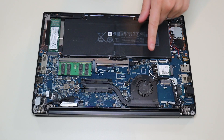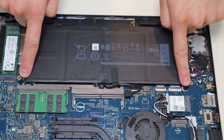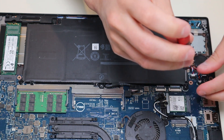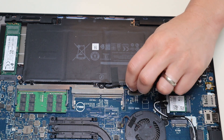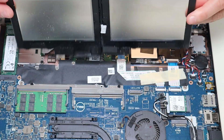This is what you're looking at for the inside of your computer. Before I touch anything inside, the first thing I always do is remove or at least unplug the battery — it makes it safer to proceed. This battery has two screws in the corner and is plugged into the motherboard. The battery plug has a simple pull tab that you just grab and pull up to unplug it, and then the battery releases.